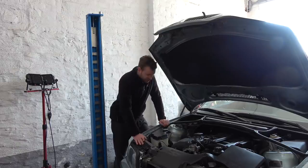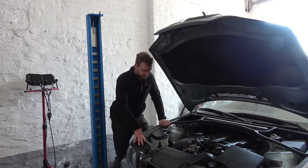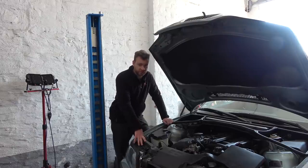I also need to change the oil and flush. I need to change the oil again because it's still really sludgy. I said earlier that I'm going to do short oil changes and that's what I've been doing — 4 or 5 of them. The oil filter is still full of sludge every time we do an oil change, so it's slowly cleaning but it's a long process. I'm going to use the Liqui-Moly engine flush. After all of that's done and we've checked for vacuum leaks, we'll go for a spin and see if this thing is fixed. It drives really nice — I drive it at 180-190 and it screams at 5000 RPM in fifth gear but it goes.